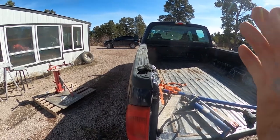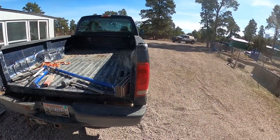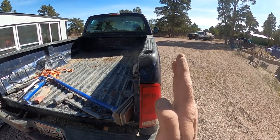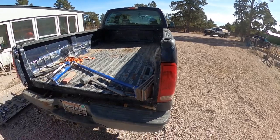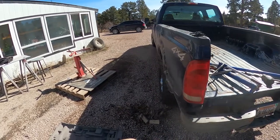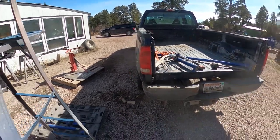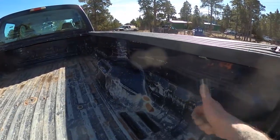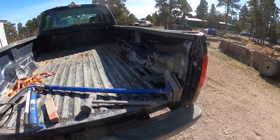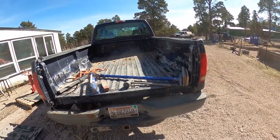Now when we look down the curvature of the top of this bed, we see the slight C-shape, which is the way it's supposed to look. This undisturbed side has a straight stock profile — you can see it's a slight C-shape, that's the way these Fords are, and that's the way this one now is. Instead of a heavy C-shape we have a slight C-shape and the side really isn't any worse for wear. It was already beat up. I just didn't want it shaped quite so badly. Now I'm going to knock up this lip up front too in the few spots it needs it, pull this bolt out, and then it'll be mostly straightened out and ready to go.